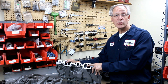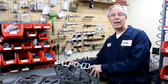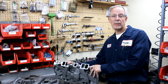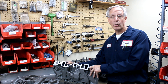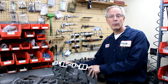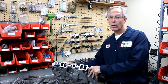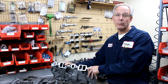These ports get done on a CNC machine first, then we hand finish them, and then we do some shot peening — putting some texture back into the manifold to make it look more stock. This intake manifold with a two-barrel carburetor is easily going to be a 20 to 25 horsepower difference on a decent small block motor. A lot of times you'd be better off with a two-barrel intake on a heavy car — a 3,200-pound car with limited compression and limited valve lift — than a four-barrel version. Sometimes smaller is better, especially if you want to come off the corner and pass somebody by the flagman.